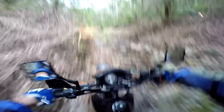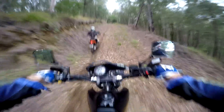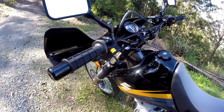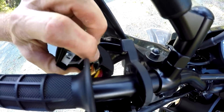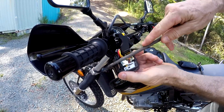The ergonomics of the DR tend to be crap, especially if you like to stand on the foot pegs, as the triple clamps push the handlebars back toward the rider too much. This can be partially corrected by rolling the bars forward, but then the switches on the bars roll forward too. There are annoying little tabs that slot in the bars to secure them - if you do want to roll your bars forward, just file these little tabs away.